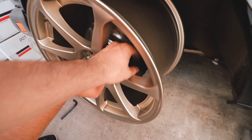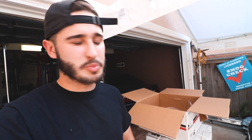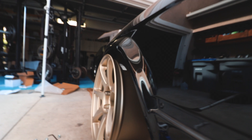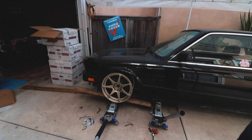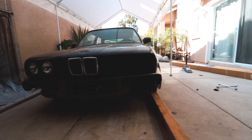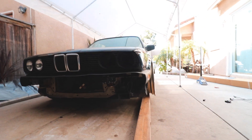Since I'm getting a big brake kit soon it's gonna clear that. This is gonna be my craziest fitment I've ever done — I'm gonna be trying to get that fender to lip on some BC coils. If I have to go stiffer springs I will, but I think I can tuck it in. I'll probably camber it about a degree or two just so it tucks right under. I'll need really skinny tires to fit. The funniest part is that the gold the car was before actually matches with the bronze — it's like a gold, not really a bronze.